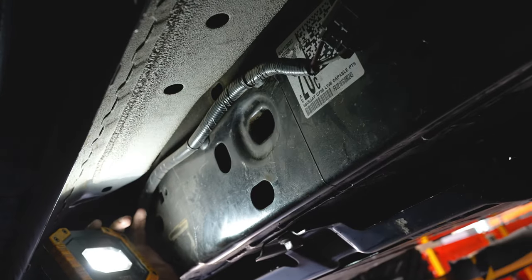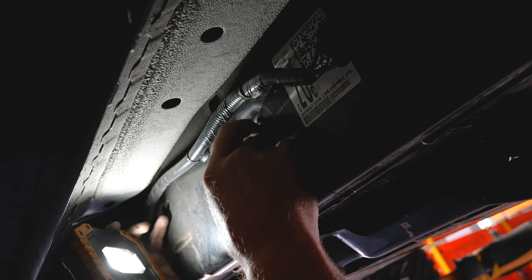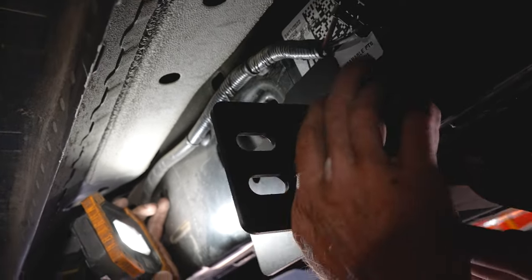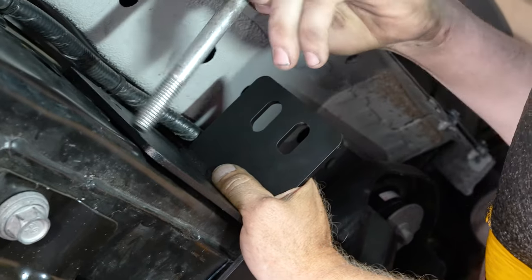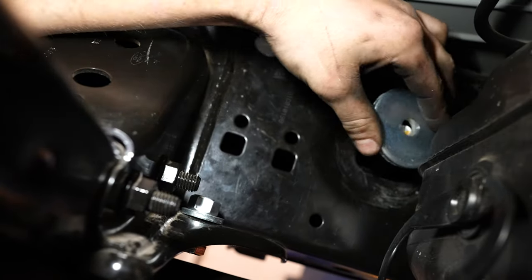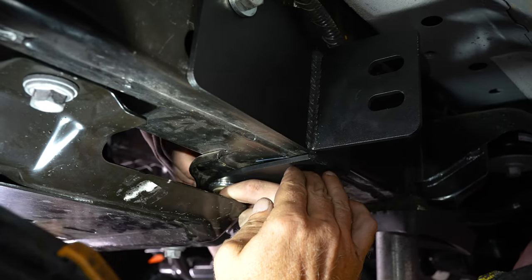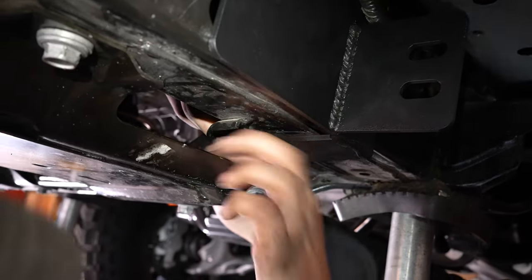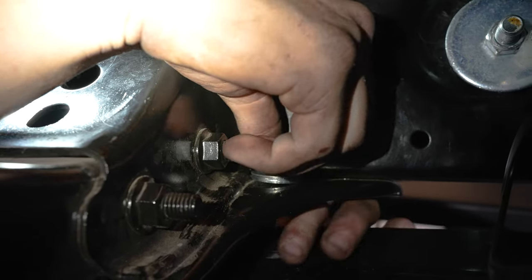Hanging the slider on the right side — our front mounting bracket, we're going to go for these two holes right here. Noah's going to hold it up. It's going to go right there. What we're going to do is put this five-inch bolt through the frame to hold it in place, then put the large washer on the inside of the frame with a lock washer and then a nut. Our bottom foot is going to our frame, going between the skid pan and the frame here. Noah's pushing the nut up from the bottom and then coming around on the top side.